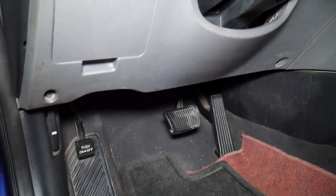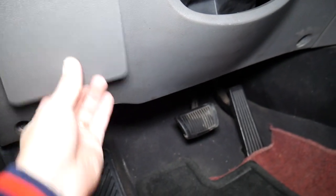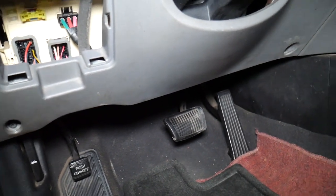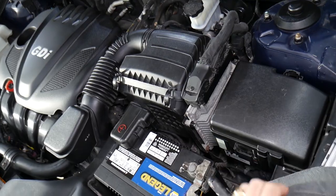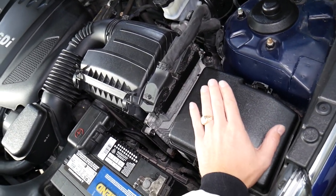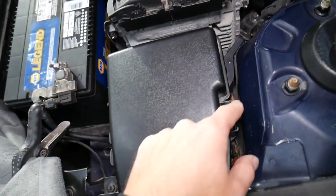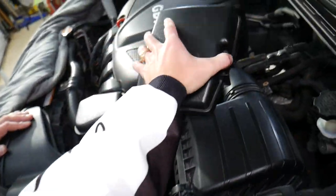So if you come inside the vehicle next to the footwell, you can see that fuse box right here — remove that cover and that's where the fuses are. Now in the engine compartment of your Kia Optima, if you come to the right side, there's a fuse box here that you need. It has one tab here and one there — squish and pull straight up.